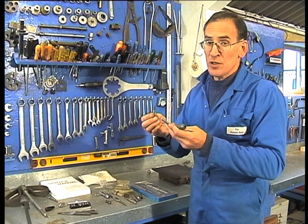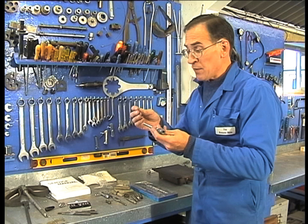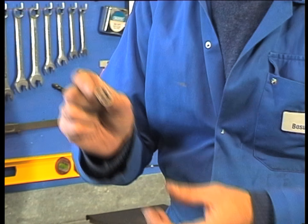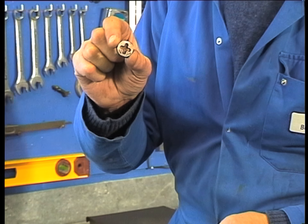Really any motor with an aluminium casting, which most outboards have, this becomes very necessary to make sure your threads are kept in good condition. If you want to re-cut the threads on a stud or a bolt, you can buy dies — again, these are all available from hardware stores.